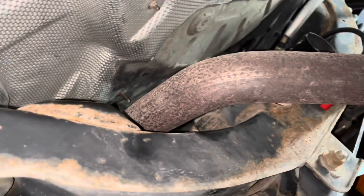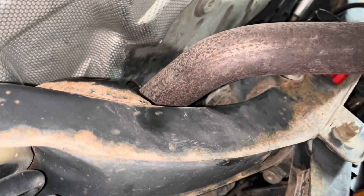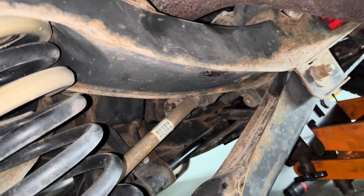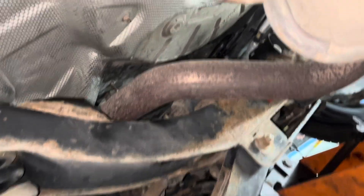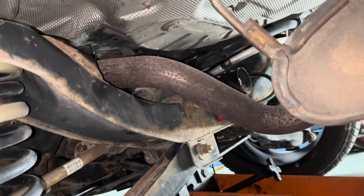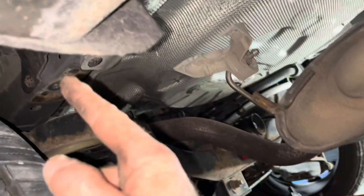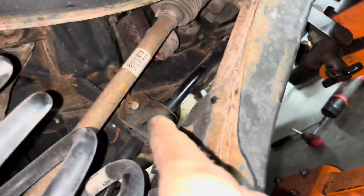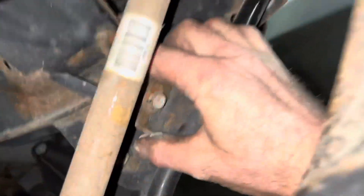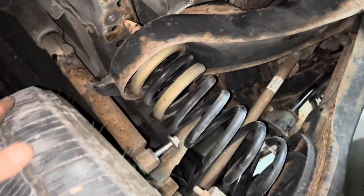We're going to throw the new canister in, mount it up, get everything hooked up. Put the exhaust back on and put the K-member back up. That is a 2014 Escape 2.0 all-wheel drive EcoBoost with an EVAP. We already did all the lines in the front. Nobody — we don't work on these for a living, so there was no information on it. This is how to do it — it's not that big of a deal if you get right to it. Take the 15s out — they're 15 millimeters, there's four of them. 13s on the crossmember and 13s on the sway bar. You don't have to take the end links loose — I don't even think you have to take the sway bar loose.